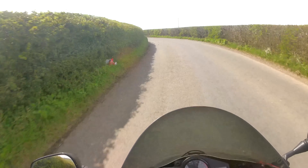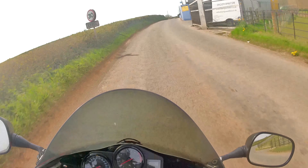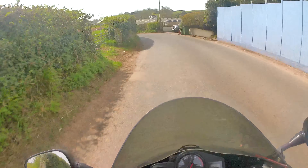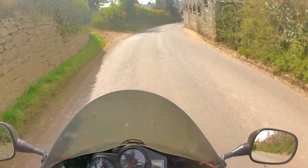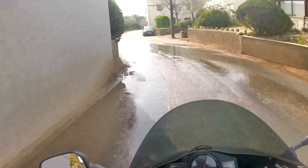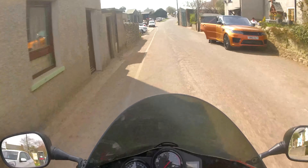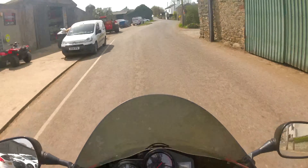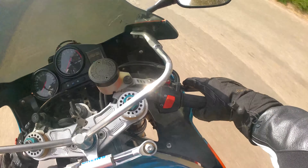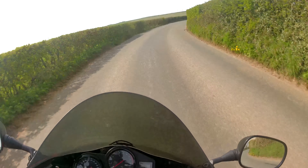Just listen to that — one third through the rev range and it's already screaming. The front brake could do with just a little bit more feel — it feels a bit slack. It could be something as simple as some air in the lines. I'm not sure what pads and calipers it's running. I can see the caliper on the back — being the Aprilia swing arm, it's an Aprilia caliper mounted underneath. The old trick of a cable tie around the front brake overnight and bleeding the valve in the morning should purge any air that might be there.